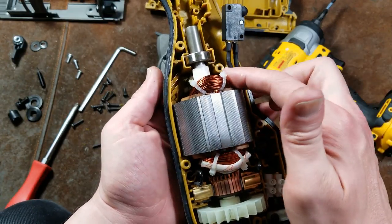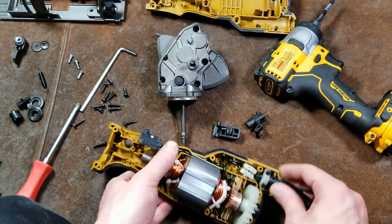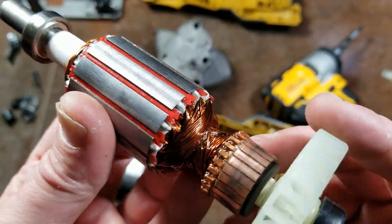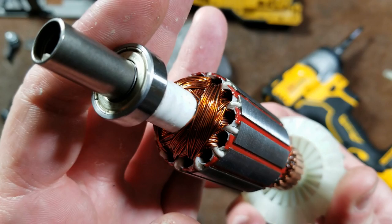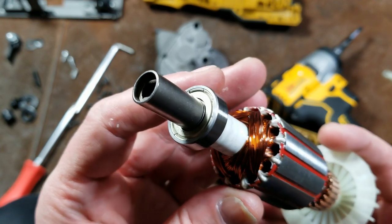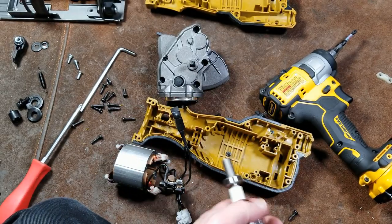It literally is a little micro switch in there, but this one has a little rubber boot — I'll keep that for other projects. It looks like a 10-amp-rated switch. Here's our motor — interestingly it pulls air in through the front and exhausts out through the rear. Here's our armature, with balancing marks. It actually looks okay; there's a decent amount of lacquer but it's not very heavy — not like a grinder-duty motor. The contacts are just pinched on there. Importantly, this is not a sealed bearing. The big issue in these tools is grit — imagine cutting tile with the diamond blade it came with, hammering that dust right through the motor and bearings. The steel shield has a gap with the inner race — these are not designed to last at all. Even the rear bearing isn't shielded.